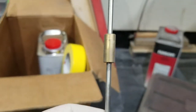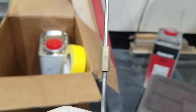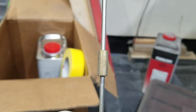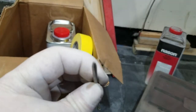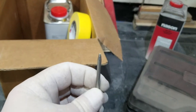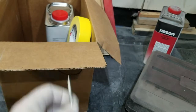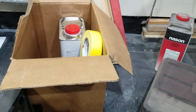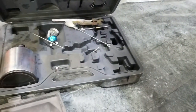You'll see, let's see if it'll come out through there. Yeah, this is a 1.8. There's 1.5s, 1.3s, 2.0s. The higher the number, the thicker the tip. The thinner the tip, the tinier the atomization of the liquid you get. What else do I have in there? I've got my other kit here. Oh, yep. Boy, if that thing could talk.